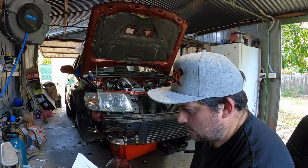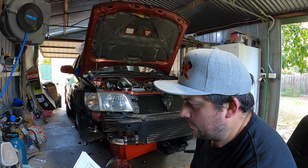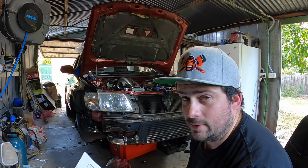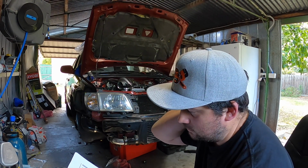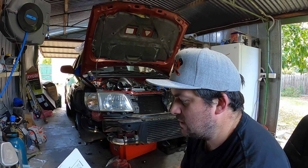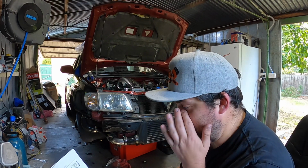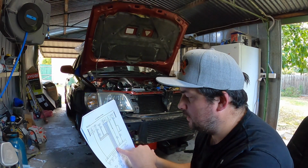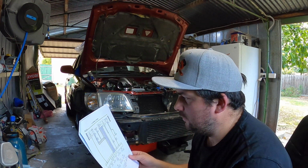So the valve body will need throttle position, probably for the ABS as well. I haven't got the ABS system schematics out, but that'll probably have throttle position as well. So probably best to get that put back in and just put the sensor wire back in. It looks like there's just power to the other one, which is still connected. Should be fine.